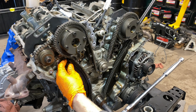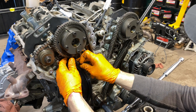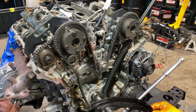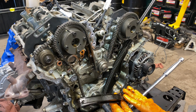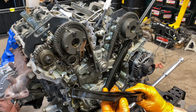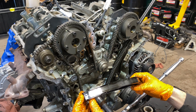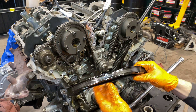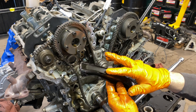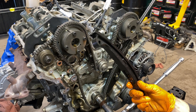The guide is now free-floating, so go ahead and pull it off all the way. There's no tension on the chain, so you'll see slack — that's completely normal. If you buy a complete kit it comes with a new guide. On this one, it's normal to see some light scoring. This guide is in very good condition — not deeply grooved. When the chain has worn it below the actual plane of the guide, throw it away and get a new one.